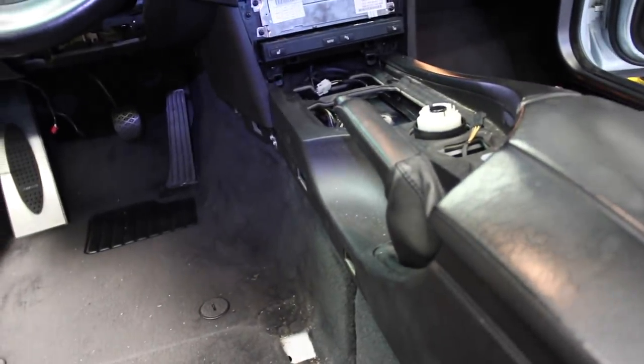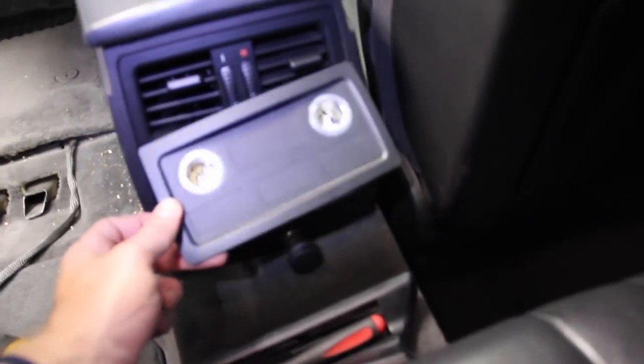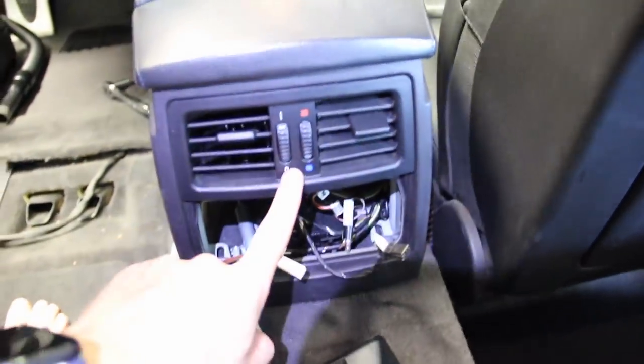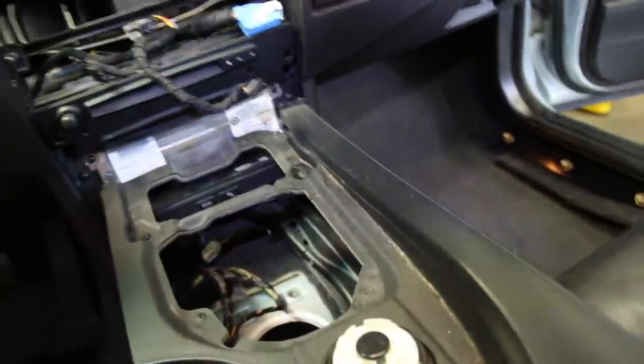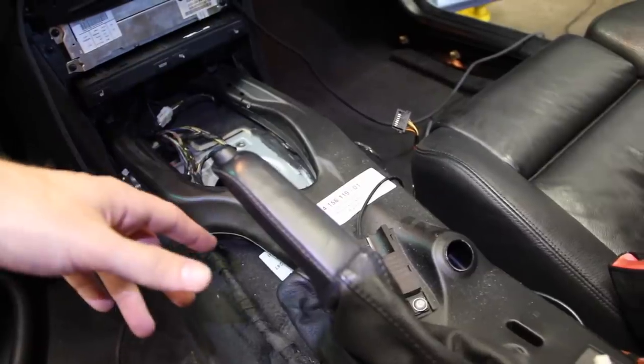Next we remove the center console tunnel. The parking brake boot just clips in — grab it and pull it out. From the back seat, use a 90-degree pick tool to carefully pull out the rear trim with the two outlets, then disconnect the electrical connectors. The only other rear connector is a three-pin that plugs up into the HVAC panel. There are also two 7mm bolts in the front that hold the center console onto the bracket — one on each side. Unplug the iDrive knob from underneath, maneuver the console over the e-brake handle, and remove a T20 bracket bolt at the bottom.